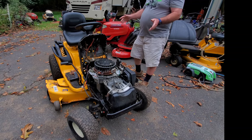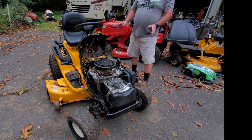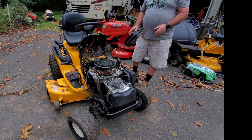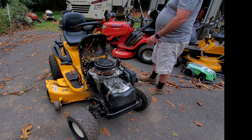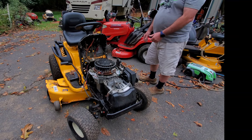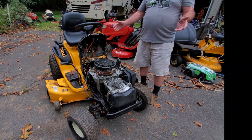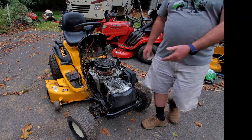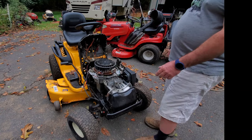This engine was put in a lot of different things. I have never seen one in a green tractor, but these yellow and white ones they used a lot. The red ones from Toro, they used them a lot. MTD — which is this one — they put them in everything. Husqvarna, the orange tractors. I've gotten really nice Husqvarnas over the years where the customer says it stopped running out in the yard, you open the hood — there you go, Kohler Courage — and you come over to this side and show them there's oil laying right there. That's what happened to it.